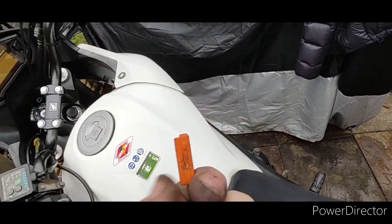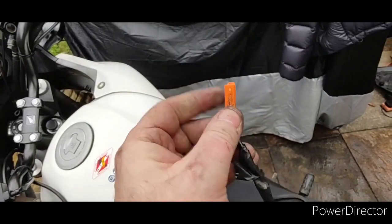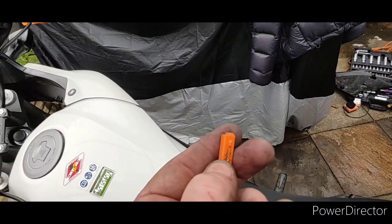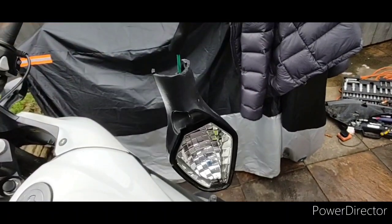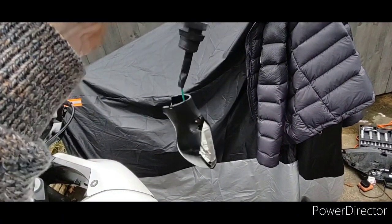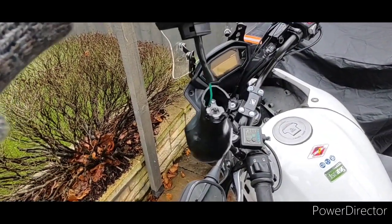This is a little clip that you try to take off. There is, when it fits in, a little shoe horn type piece that comes over. So when you push in, it slides over that little ramp and clicks into place. With your smallest screwdriver, you try to push it under the shoe horn and then just move it forward, and it should pop out. Being Scottish and a cheapskate, I'm going to try and rewire this and use it again — though I'll probably end up spending a couple of pounds and crying as I buy a new one.